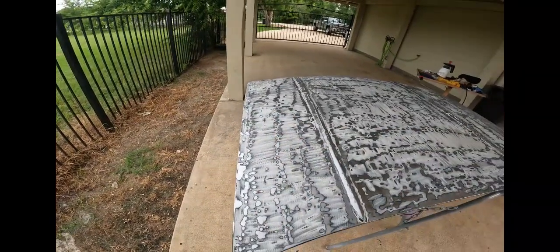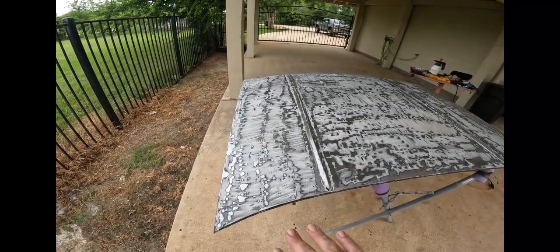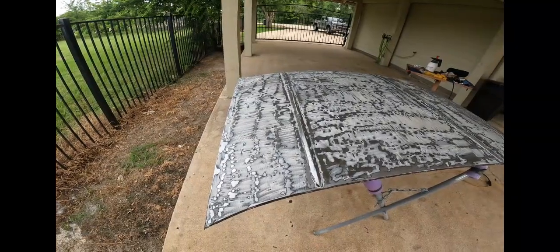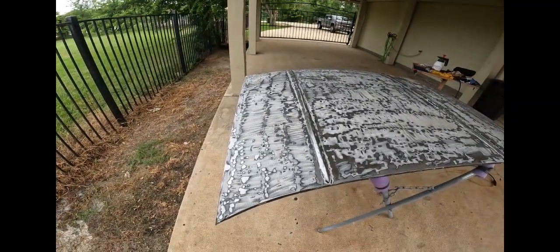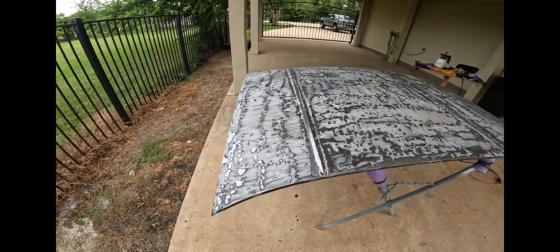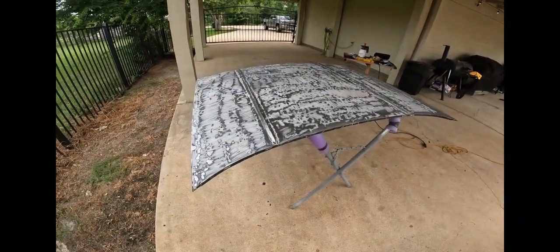It's probably overkill, but I didn't want to start digging in and getting to the metal with a bunch of grease slinging everywhere, because then it might get stuck in the metal and who knows, might come back later. So I cleaned it up first with wax and grease remover, then hit it with that disc. Let me get this other disc set up, and we're going to knock the rest of this out and bring you guys back.